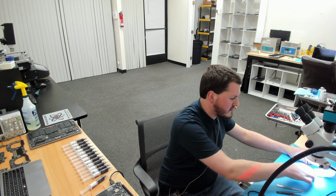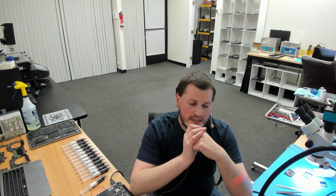And we're going to show if there's any separation here and what the paste overall looks like after being exposed to those kinds of temperatures. Now, a lot of thermal paste, especially the high-end enthusiast thermal grease, not MX4, but some other ones, start to degrade fairly quickly at higher temperatures. Around 80 Celsius, they start to harden and degrade and possibly crack. Cracks you really don't want in thermal compound because dust and other contaminants can work their way in there, get up over it, and that can seriously impact thermal transfer. So let's have a look at what this paste looks like after a really extreme durability test.